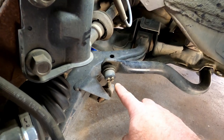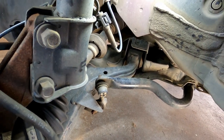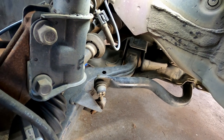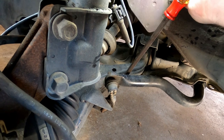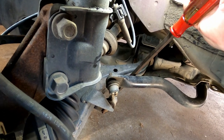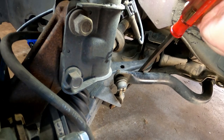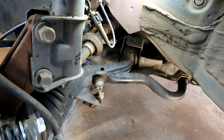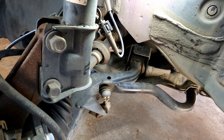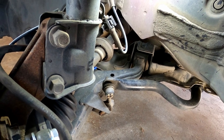What can happen with the sway bar end link is they can break, get old, or start making a lot of noise. To test it yourself, come in with a screwdriver or some kind of pry bar and get behind it, then move the end link and listen for any noise. This one's actually pretty quiet, and the other side is quiet also, but I've already got the parts from my suspension kit, so I went ahead and decided to switch these out.